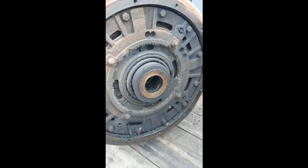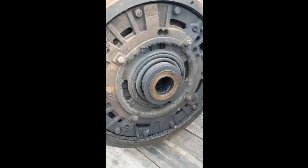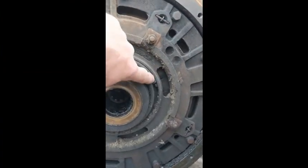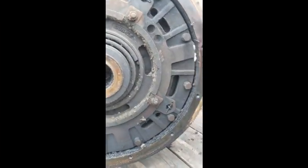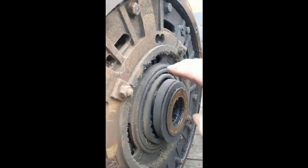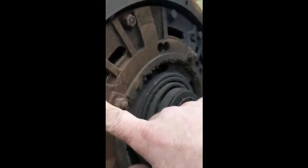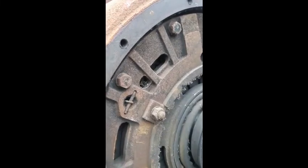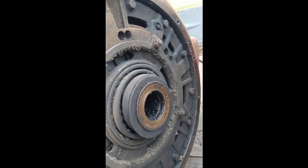This, my friends, is what they call a pot-style pressure plate. The pressure plate bolts on here, and if you look really close you can notice that this is a flat spring in a circular manner — it kind of cones out, so when you push on it, it releases. There are little fingers here that hold the segments in place. I'll get it apart and show you, but it's what they call pot-style. I don't know when they quit using them.